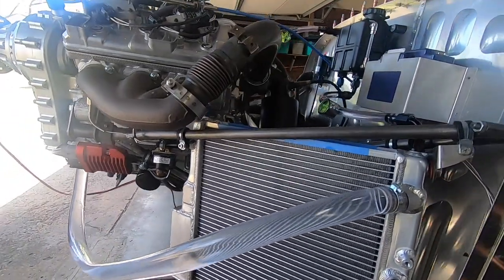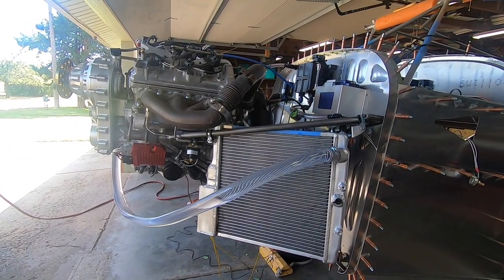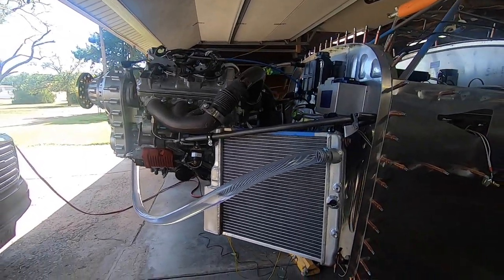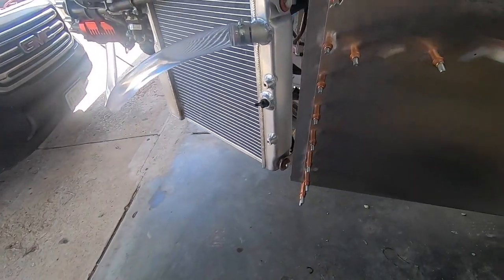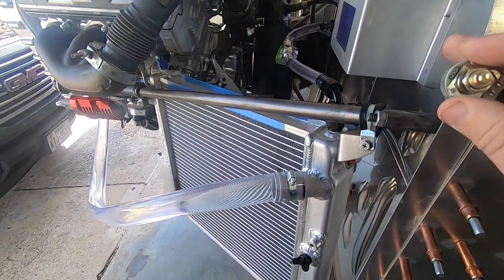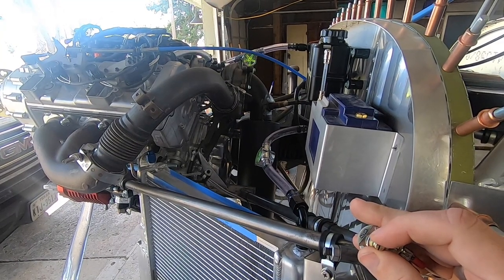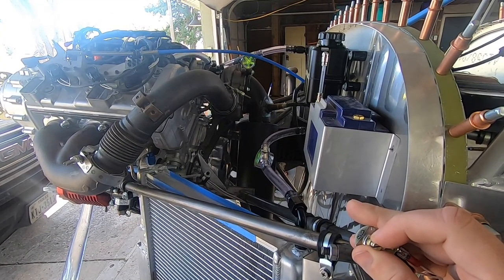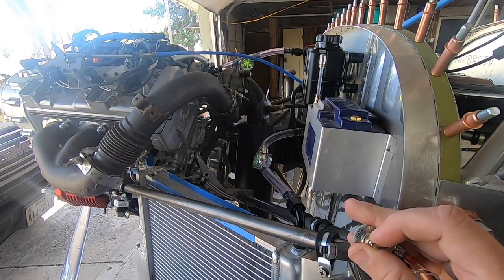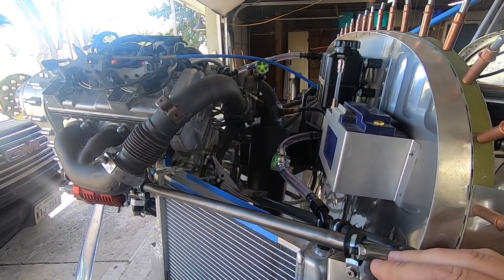As always, I'm not advocating that you follow me in any of this, and for all I know it could turn out to not work, resulting in me retreating to a more stock setup. Only time will tell. I've temporarily set up my engine with clear tubing, utilizing some flow meter wheels to monitor the flow, as well as a ball valve that simulates the thermostat. I don't really intend on running a thermostat unless the minimum flow of my pump prevents reasonable engine warmup times, and I won't know that until I get things started.